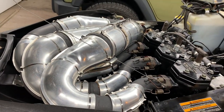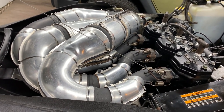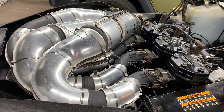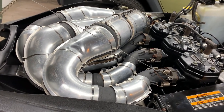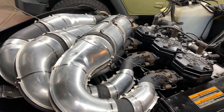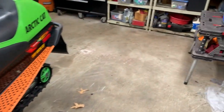I've done this process on seven or eight sleds and I've never had an issue with paint chipping or flaking off. With any type of paint project, prep is the key — if you just take the pipes off without any prep work and paint them, it's going to peel, it's not going to bond or adhere. So that's my process for painting pipes.